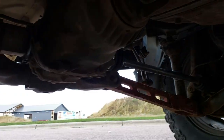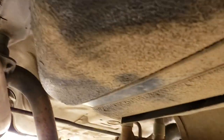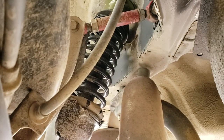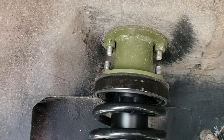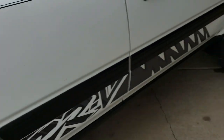That's all for the rear drop — it's obviously two points over there on the passenger and driver side that it mates up to, and then also the differential. You can see the Trueheart camber kit — that is absolutely a must if you want it to sit right. You can get away without these things, but you're not going to pass inspection and it's not going to be a very nice drive on the road. There's a two and a half inch spacer kit from HRG in the rear.